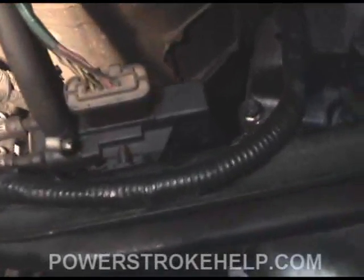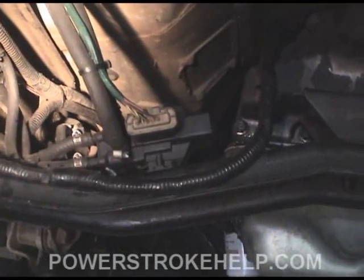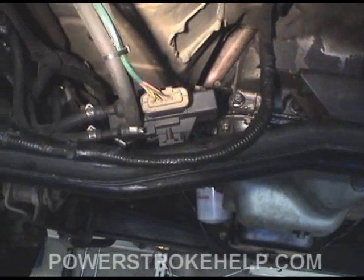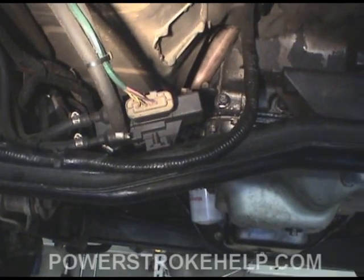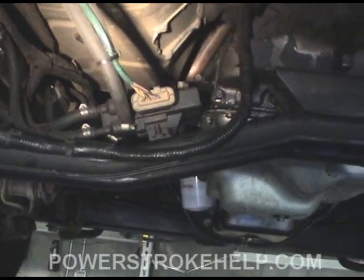This entire switching system is a factory Ford switching system — even the wiring and the plugs I took out of a wreck, so there's no question in terms of reliability. You want to use the highest quality rubber hose in this process. Regardless of whether fuel is pulled from the main tank or the alternative fuel tank, the first place it goes is to a Racor filter.